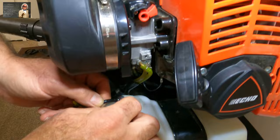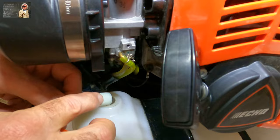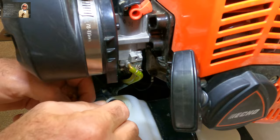You can make these filters last even longer by cleaning them. All you have to do is take your carburetor cleaner — when you have the filter off, stick the straw inside and move it in and back as far as it'll go, spraying it. The carburetor cleaner will flush all the dirt out of the filter, and you literally can put the filter back on, saving yourself even more money.